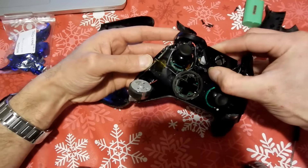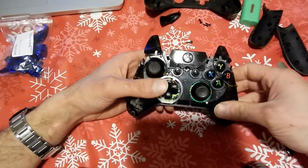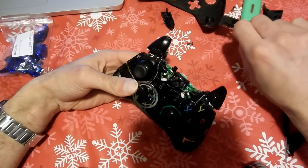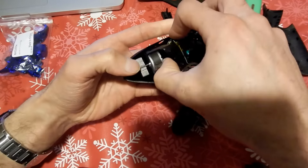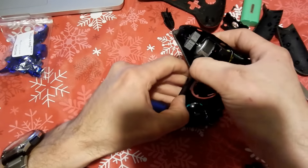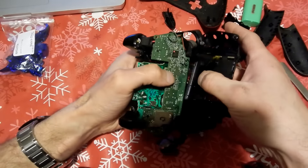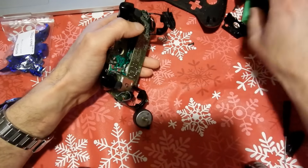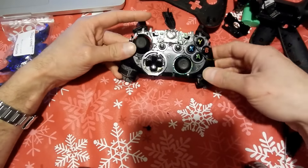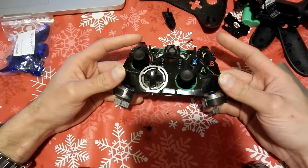Now the next step is to pop out the top plastic cover on this specific controller. It should just snap off from the front — it comes off just like that. Once you've done that, you're ready to remove the back cover. The connections on the bottom where the headphone jack is — you want to pry upwards to loosen it, or you can loosen the top and slide it downward. I'm being very careful with the bottom motors, keeping it close to the table so nothing's hanging and ripping cords off. That's how you get the back and front cover off the controller.